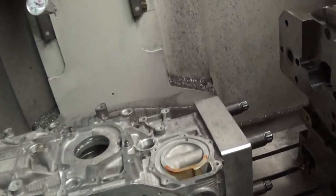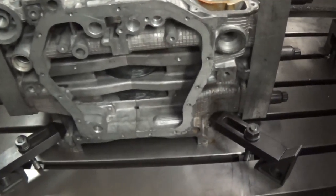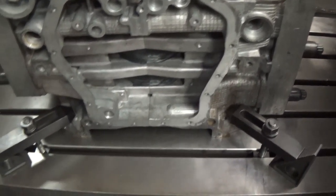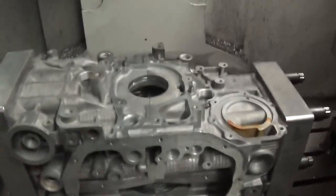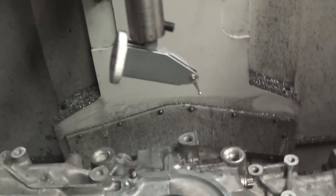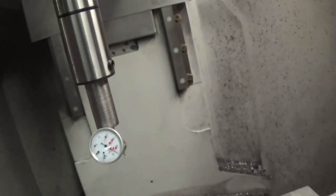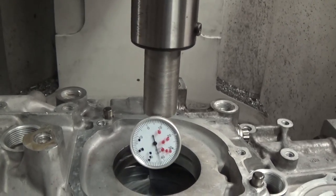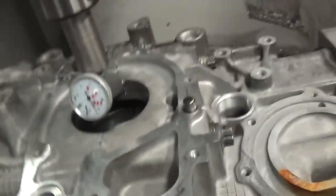I put the block in there and I only clamp these straps to five foot pounds. It doesn't take any pressure at all to hold the block. After I roughly center the number one main, I come down with this indicator — I'll show you the indicator. It's just a tenth indicator that I adapted onto my Kaiser Stub Borer here. Forgive the funny marks on there, but when you're upside down in that number five main, it's hard to figure out which is positive and which is negative, so I've got it marked in red and black.